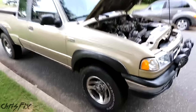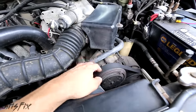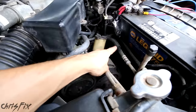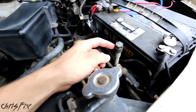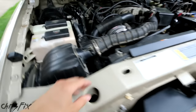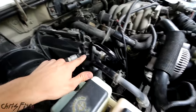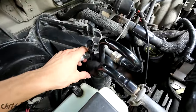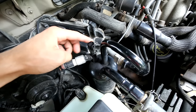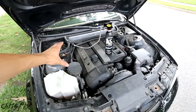On this vehicle, find the AC compressor and follow the AC lines. Here's the high pressure AC line and you can see the service port capped right there. Then it goes into the condenser and comes back around here — here's that nice thick AC line going to the accumulator, which removes moisture from the refrigerant, and here's the other cap. This is our low pressure cap, so we could fill my truck right from here.